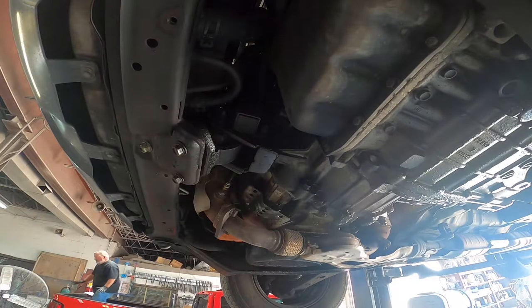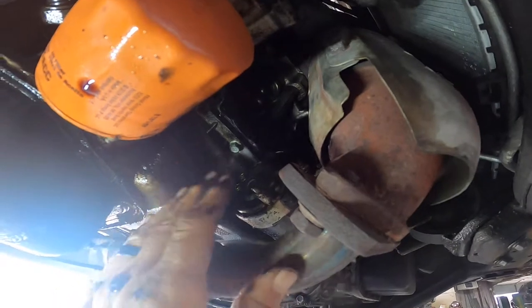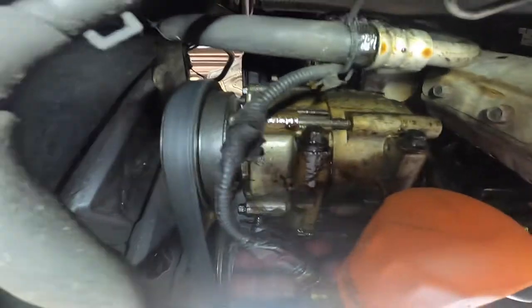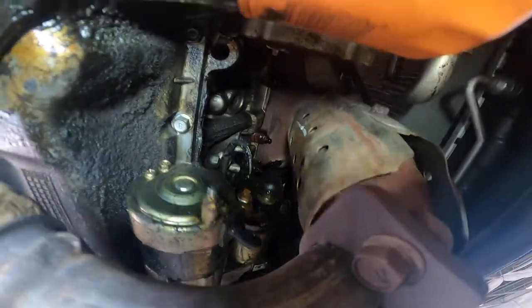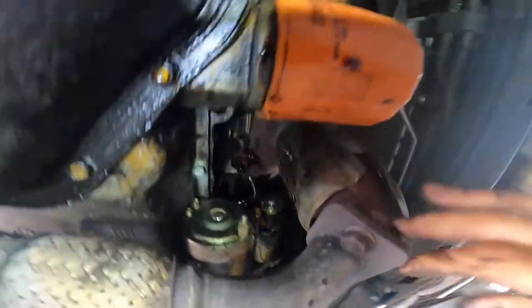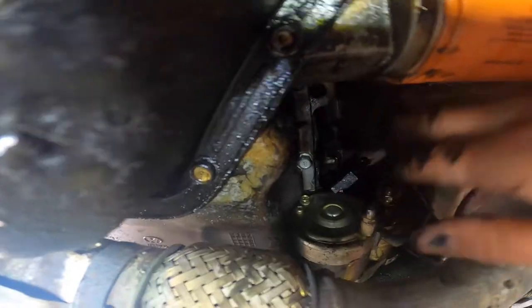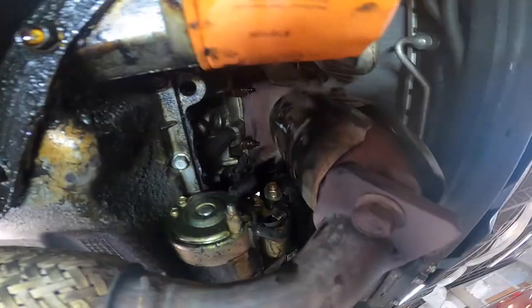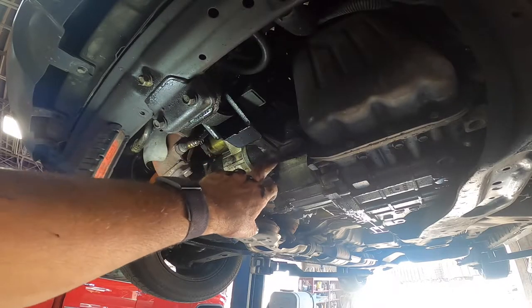I don't want to be drenched in oil. If you look back here, this is the electric connector — it's got oil dripping out of it. It's unfortunate they don't want to do that valve cover gasket because it is not going to give them nothing but trouble. It's even all around the AC compressor — this car is just oil saturated, it is leaking atrociously. Next, we need to go ahead and disconnect the starter solenoid — it's one plug and I believe it's going to be about a 13. To get this connector off, there's a little tab you've got to push down and it just pulls off. This is the battery voltage wire coming off the battery, and this battery wire is a 13.